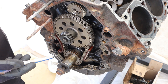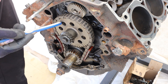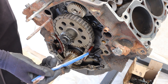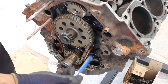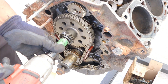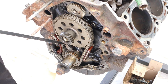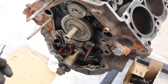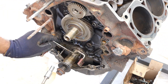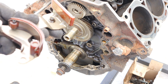And there's actually a timing chain. The timing system on the overhead valve engine is very simple — you just have crank, camshaft, one chain, that's it. And there's a tensioner. Now there are these plastic slides inside of here that are backed with metal, which is good because it will be nice and strong. Let's see if I can crack this cam bolt loose. Should be able to slide this out at the same time, and then we can pop the timing set off. Let's get the tensioner off. The tensioner is really simple — it's just two slides, no hydraulics, no springs, nothing involved.